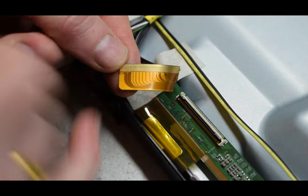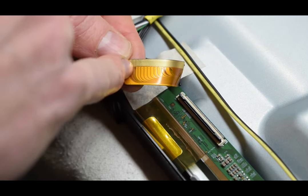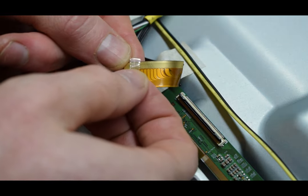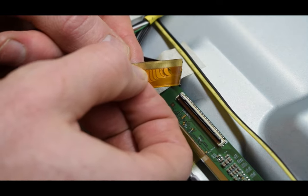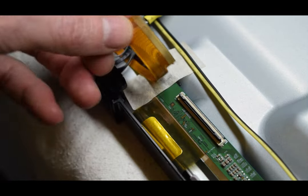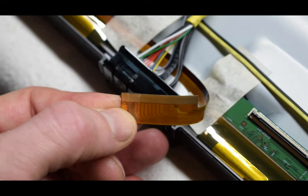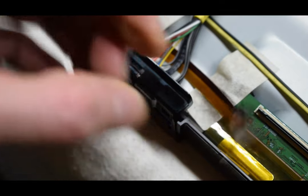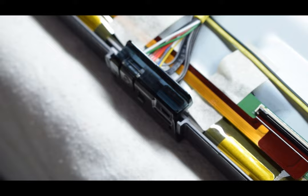I actually found where my bad wire was — it was right beside the bigger ones; there's a really small, thin one. If I just tape right over that... obviously this one's too thick — you're going to have to use something just like a hair. You're going to first do this to identify which pin it is, and then just keep moving it along. I'll show you guys where I put it — just right there. After you connect it and it's not doing that boot cycle, you can actually reduce that, because there will be lines on the screen since we're disabling some of the horizontal lines.